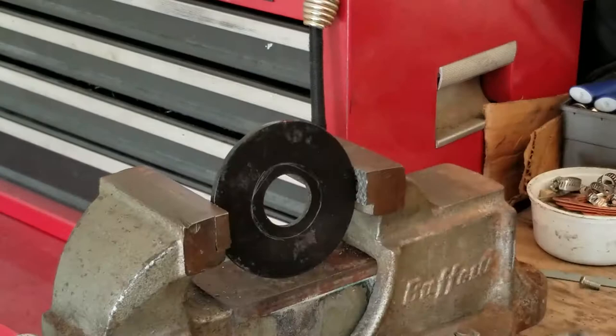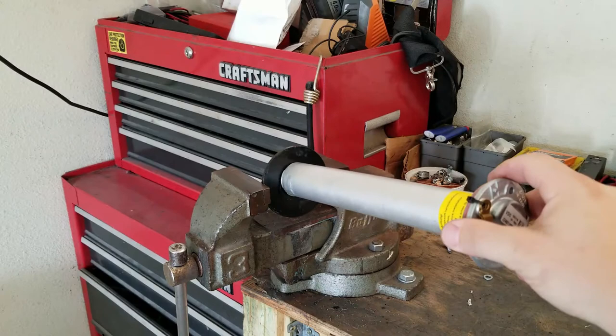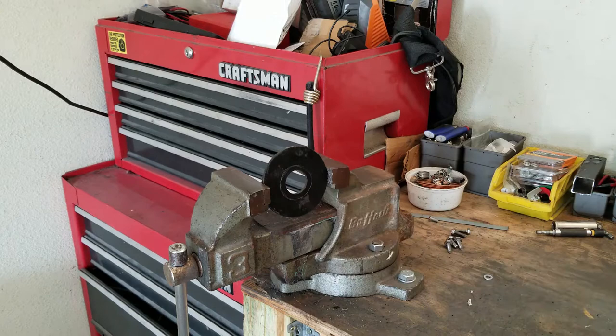back you guys up for a second. When I put the fuel sending unit into the tank, instead of having self-tappers that go into the top of this, it's going to have a plate on the inside of the tank that I'm going to drill and tap for hardware, for bolts, instead. And I think that sandwiching effect that's going to happen is going to be a lot better seal, and it'll work a lot better when it comes to installing this.